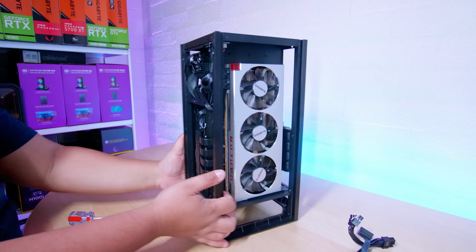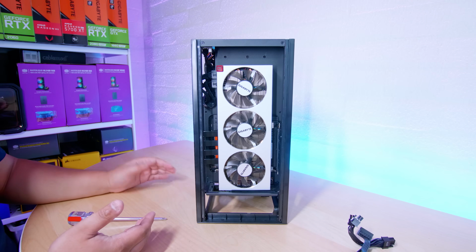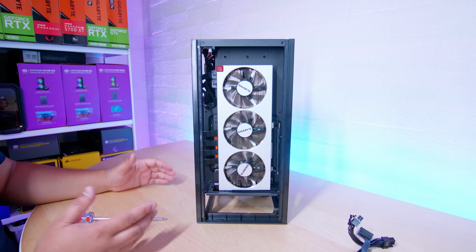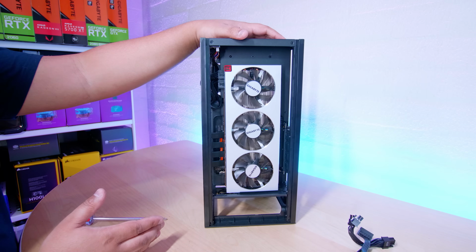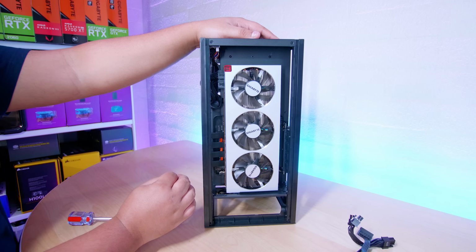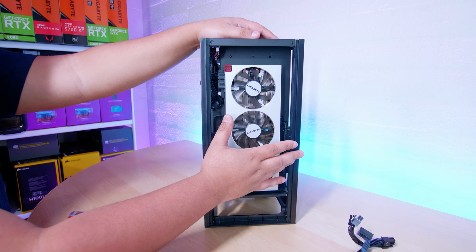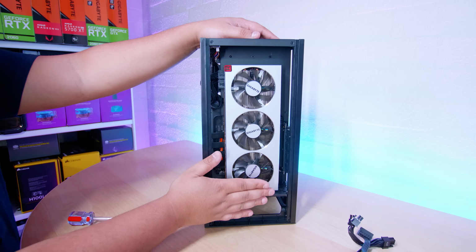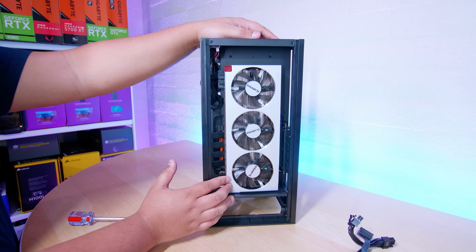You probably also noticed that I went with the Radeon 7 in this build, mainly because it's one of the only GPUs I had that was a true 2-slot GPU. However, I think you could possibly go for a 2.5 slot, but 3 slot would be pushing it, and it would probably sit right up against the side panel, or it probably wouldn't allow you to slide the side panel on. But I don't have a thicker GPU at the moment to use, so I can't test that.